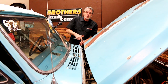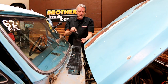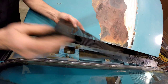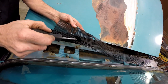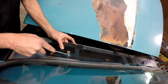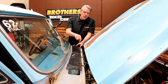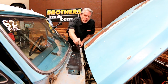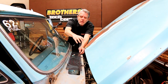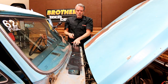So I'll get the rest of this off and I'll show you how to put the rest of this stuff in. With the cowl out, we can go ahead and install our trash guard right here. What you're going to want to do is put both sides down. You'll notice that the holes are already punched out for your screws to go in, your wiper arms, and your water to spray on your windshield. Line up the holes here — it comes with two little screws. We're going to put the two pieces together and make sure that they line up in all the holes.